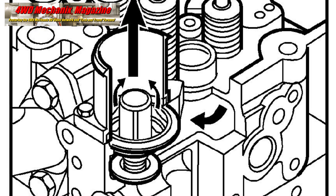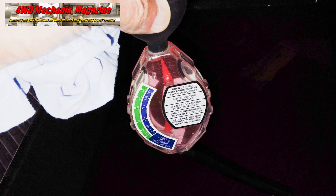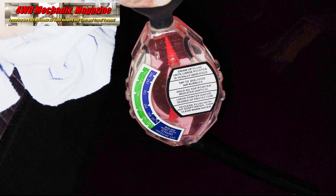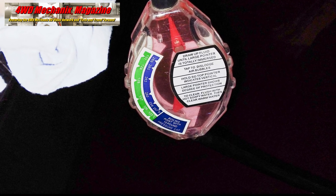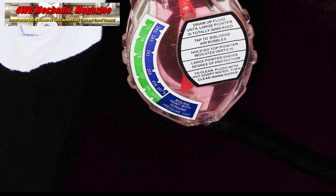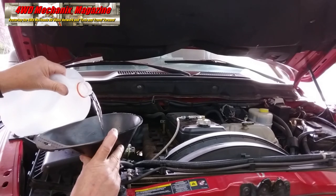The truck is driven an additional 15 minutes at cruise speed to flush the system. Back at the shop and cooled down, I drain and check the flush water with a hydrometer. It does not show any antifreeze protection, indicating that most of the original coolant is gone. Many would stop here and refill the system with fresh coolant. I can tell by the coloration that there is still some old coolant present. I refill the system with pure distilled water and drive the truck for 15 minutes after a warm-up.